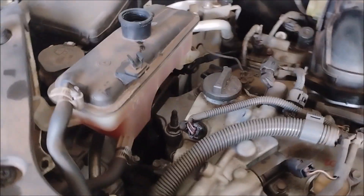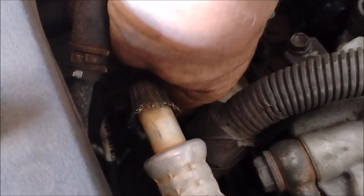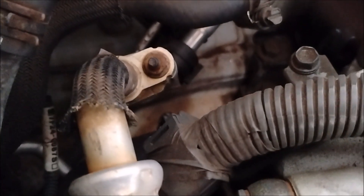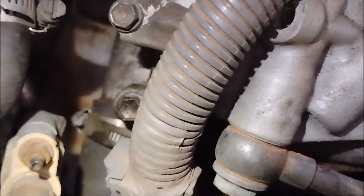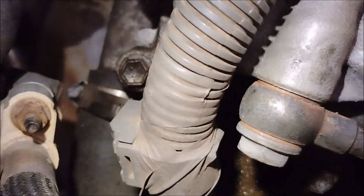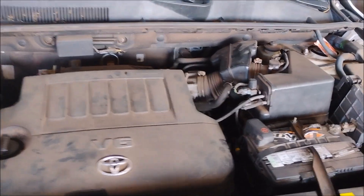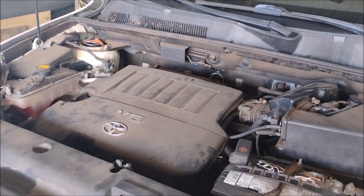The engine is running — how will I know when the thermostat has opened? I'll know because this radiator hose will turn hot; up until the thermostat opens, while it's closed, this hose remains cold. A word of warning: as you go to check this hose, the alternator pulley is right underneath it, and if you're not careful it'll slice your finger right off, so please be careful. That's all there is to it for this repair — this car is now ready to go. Thank you for watching; if you have any questions or comments please add them below.